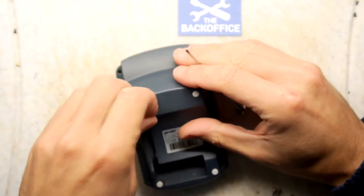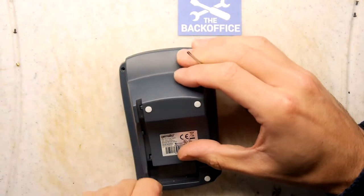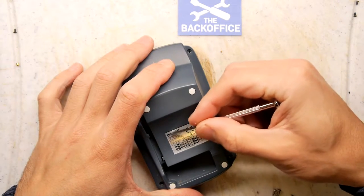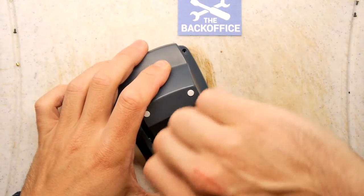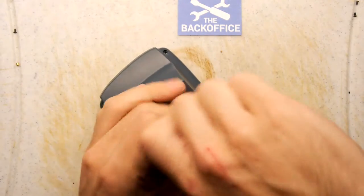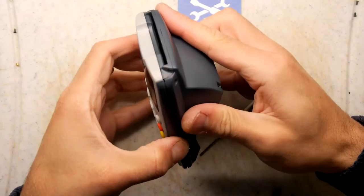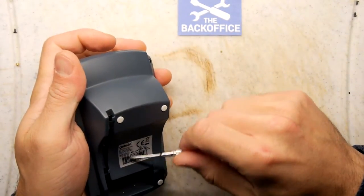So it's not prising off — no feet there, no foot there, no foot there, and I'm pretty damn sure no foot there either. Sometimes if you've got a foot behind the label just sort of poke across. There we go — secret foot! Just poke your screwdriver across the label till you feel a divot and if you do, stab it down. All your Christmases will come true.